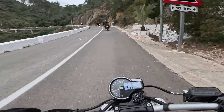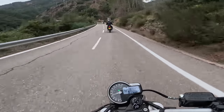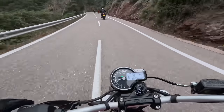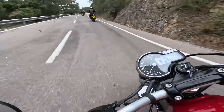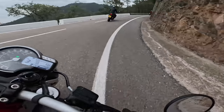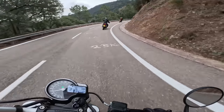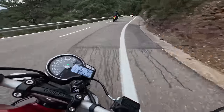The Speed 400 also has road tires and slightly taller gearing than the Scrambler. I found the Scrambler was doing really well carrying third gear even at low-speed corners, and the Speed felt really similar — really nice, even in third gear coming out of the hole. I definitely get a better front-end feeling on this bike than I had on the Scrambler. The Scrambler sometimes had a bit of a vague feeling on the front end. On the Speed, the suspension is pretty taut with less weight transfer, and the front brake has a little more bite.